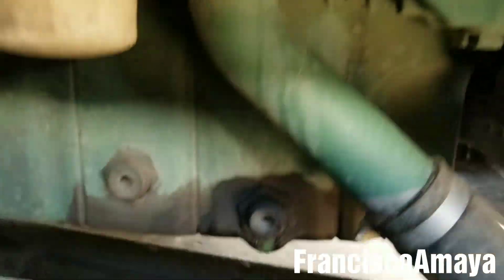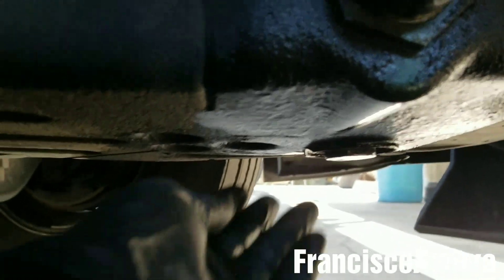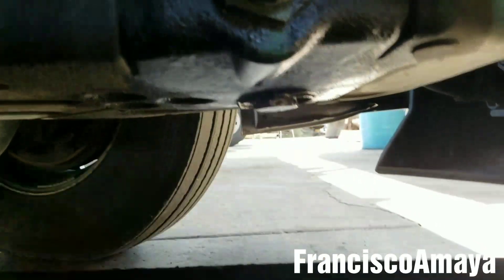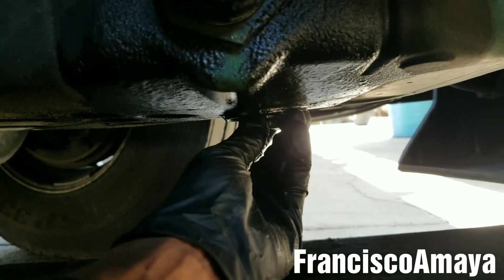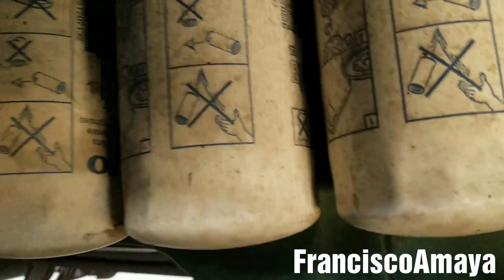The first thing we're going to do is open the drain plug. In this case, the drain plug is right here — you can see that one over there. You're going to use the one-and-one-quarter tool to remove it. In this case I already loosened it, so you have to have something to collect the oil. Now we can open this drain plug so we can collect the oil.